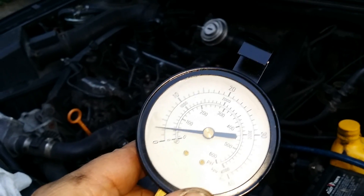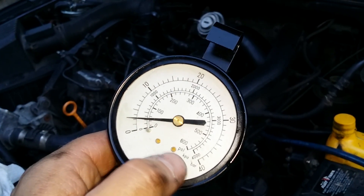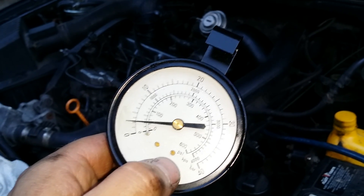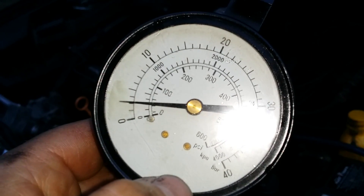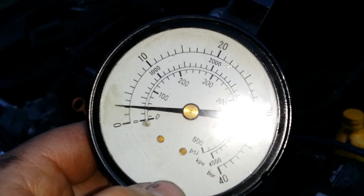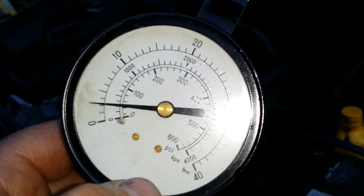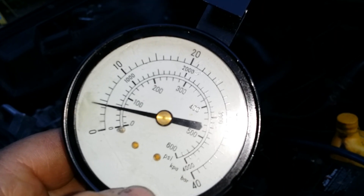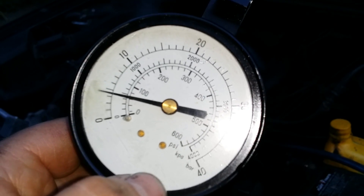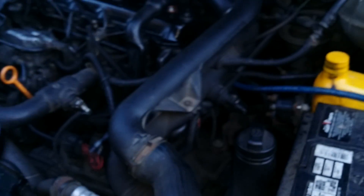You can see it's got about 40 PSI — that's PSI, not bars. It's got about 35 to 40, which is normal. Now we'll rev it up to 2,000 RPMs. At 2,000 RPMs it reads 50, so that's good — but that's not good overall.